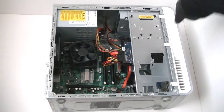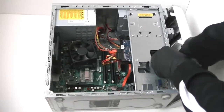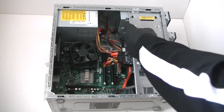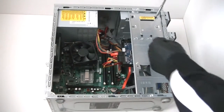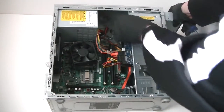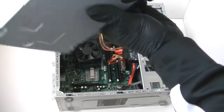So you're going to remove the front panel — just press this up right here on the secure clips, and it comes right out. Now we're going to disconnect the SATA cable going into it, the power connector cable, and the optical drive. You'll need latex gloves like I'm wearing, and get a Phillips screwdriver. The optical drive — DVD burner — comes right out.